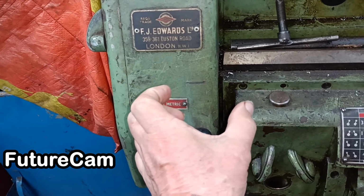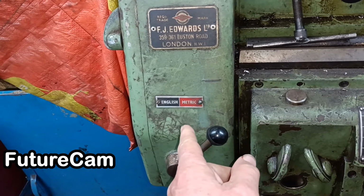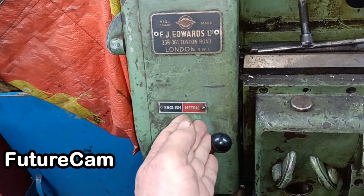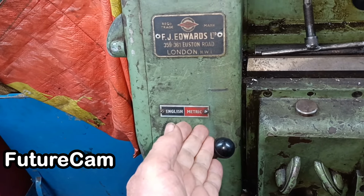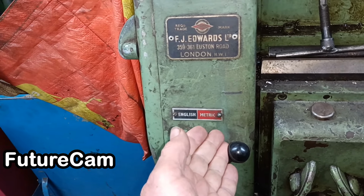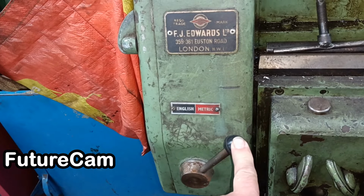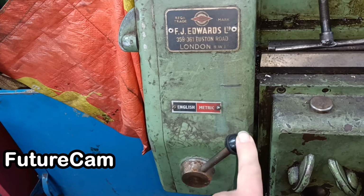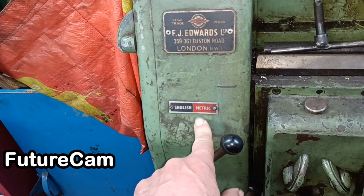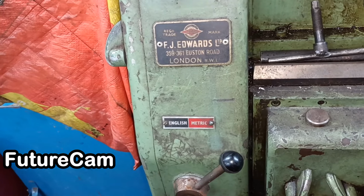So that has introduced a small pitch error when I did the single point cutting, and the die can't correct that. That die that I showed cut one thread, and it's so cheap it just wouldn't cut another. All it did was rub. It was a waste of time. But I've just had a light bulb moment as I was sitting editing it, looking at me struggling, and that's why. It's a 125 over 127 error. So there you go, I messed up. Okay, back to the normal program.